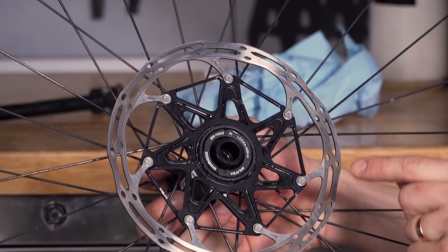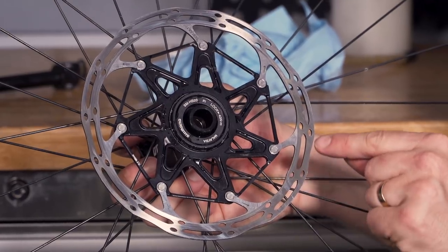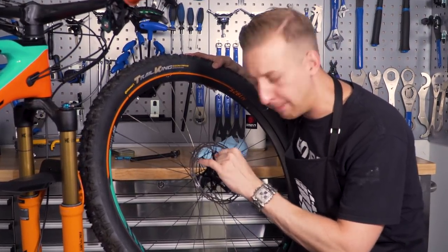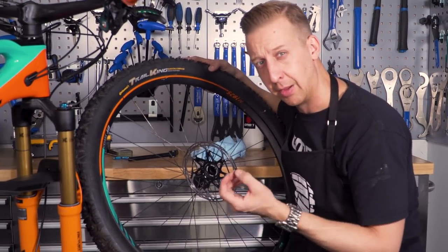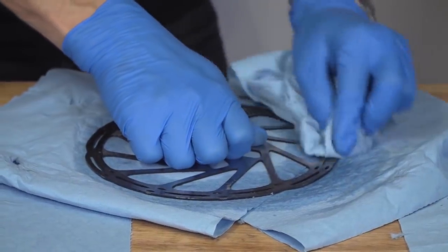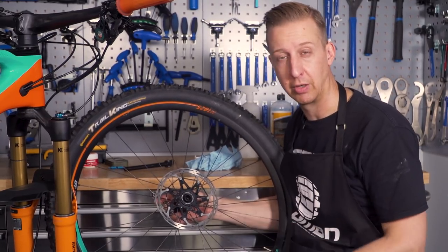Whilst the wheel's off the bike, inspect the disc rotor and look at the braking surfaces. Avoid getting your fingertips on the actual braking surfaces, because oil in your fingers can affect the brake pads and those braking surfaces. What you're looking for is any sort of heavy pitting, ridges, or scores in the rotor surfaces that might have happened from worn out brake pads, or if they look glazed or polished over. If that's the case, you can clean them with isopropyl alcohol and use fine emery paper on them to restore some grain to them, then re-bed your brakes in. Because brakes are a safety thing, I recommend doing it sooner rather than later.